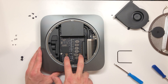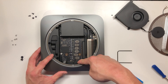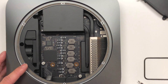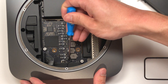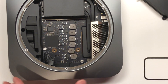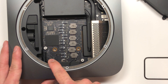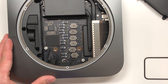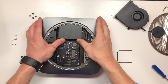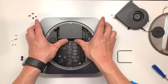After we have removed the two logic board screws — which again are T10 — we are going to remove this one connector up top right here. We simply just pull up on it, so I'll just use a screwdriver, pop it up, and that will remove that one. And then we are going to remove the power supply — simply just pull up on that and that disconnects. After those are loose, we will push against the heat sink, which will push the entire logic board out of the computer.